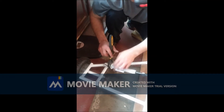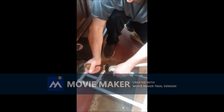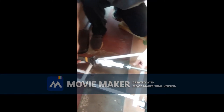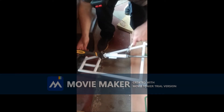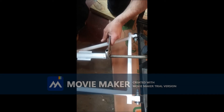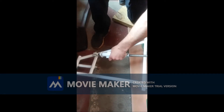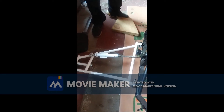I'm gonna take these apart and make a video to show how it works because this can confuse a person. So it bottomed out right there - that's your set height, that's bottomed out to this wide round washer. This piece right here gets tightened up against that. What you want to do is tighten them against each other - it doesn't have to be really hard, just like that. That's good to go, that's not gonna go anywhere. This won't go back and forth. You do the same thing on the other side. And that's how you adjust the height or the axle - that's how you set the height for this machine on a bike.